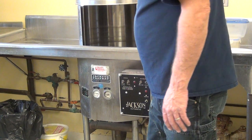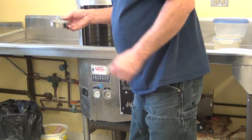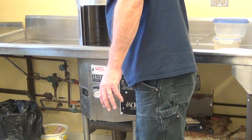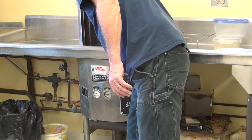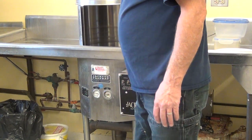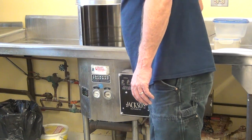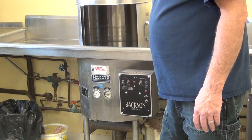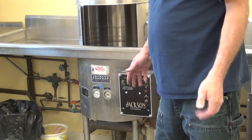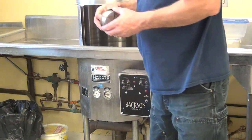There's another strainer. You have to reach your hand down into the hole for the drain overflow — it's off to one side. You reach down and put that strainer in the hole that's to the right, there's a port that comes off the side of it. That's not a daily thing — you just check it, keep an eye on it. I do it every time — clean it up and check those rinse arms. You do find it dirty even if you do it every time; there's stuff that gets through.